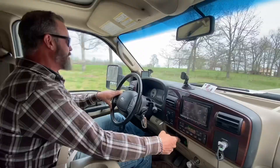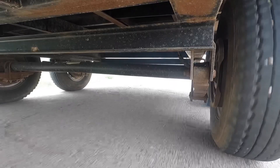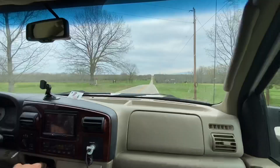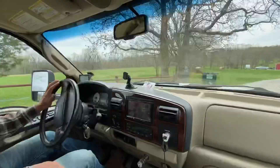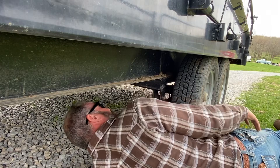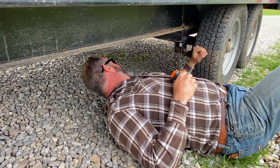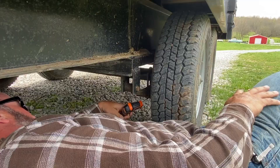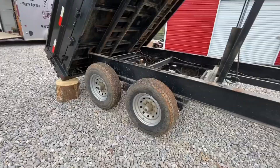We're not gonna time these stops as they're getting hotter — they're fading worse. This is our third stop and they're really not doing much now. We're gonna pull back into the ranch; I'm gonna have to use the truck brakes to slow us down. The brakes are smoking — this brake drum is 603 degrees, while this other brake is at 105 degrees. A massive temperature difference — this one did the most work, while the other had way less heat.